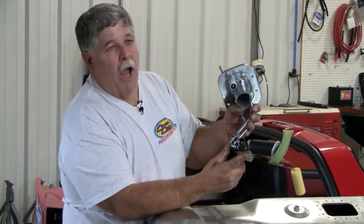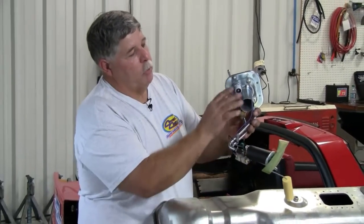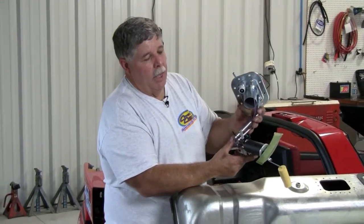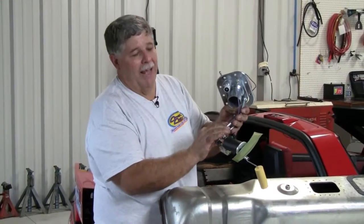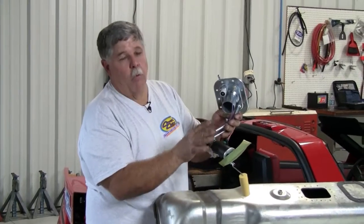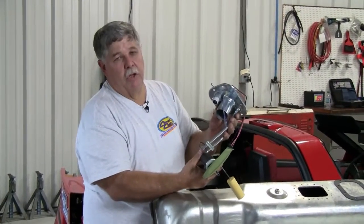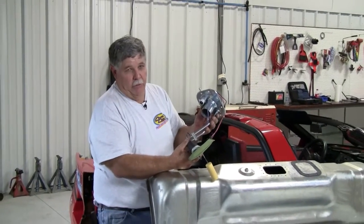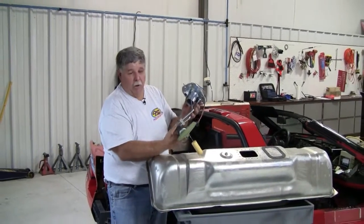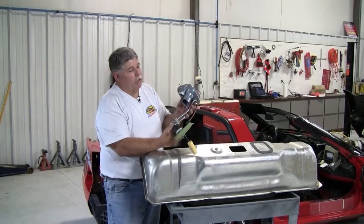You're probably thinking: why would I replace the full sending unit? Why would I just replace the pump? Unfortunately, we've seen a whole lot of issues with the sending units, and the only way we were able to fix that is to go ahead and replace the sending unit as an assembly. Believe it or not, the particles that would end up coming off of the sending unit, even though there is a fuel filter, will find their way to your fuel injectors — and we're talking about a lot of money compared to the cost of the sending unit. So the best policy is to replace the unit as an assembly.